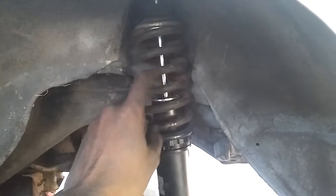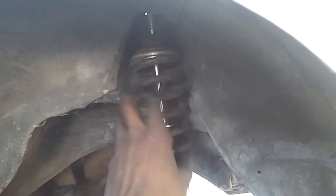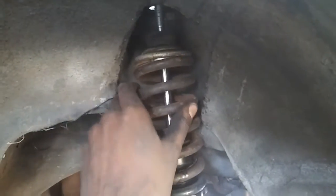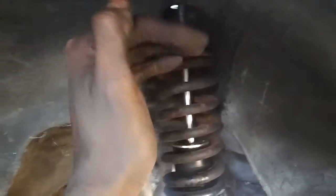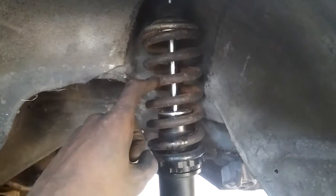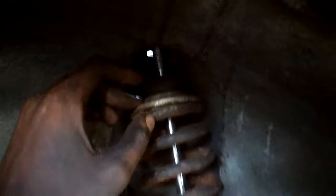I used my Raceland damper with a TN spring because the Raceland coilovers' diameter is a lot bigger, so the TN spring has better clearance all around in diameter. I used the little cap from the TN spring too. It's like a rear-front coilover hybrid, because the rear coilover actually mounts up against the top and bolts to the strut tower in the rear for the S13 coilovers and the 240SX, but I used the front from the TN to make it so I have the spring attached.